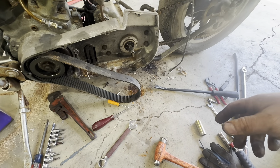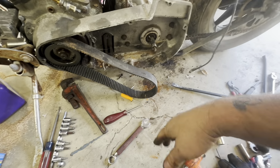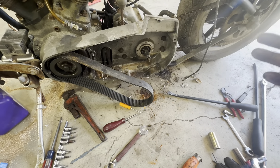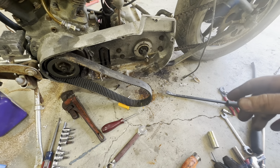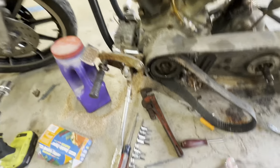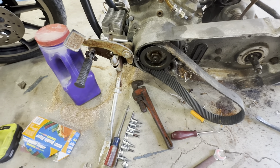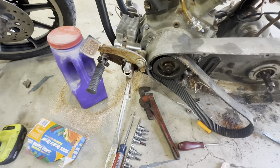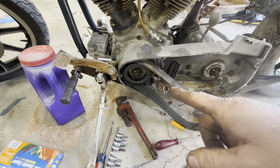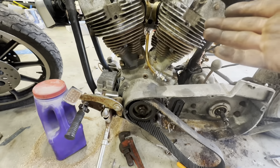People will go around and beat the crap out of it at an angle, but all you've got to do is put your pressure on and hit it straight. It's just like taking a bearing out of a flywheel using grease and an extension — there are all kinds of little tricks to it. Now I need to find an inch-and-a-half socket because that nut is massive. This one is regular thread, and I've already got it soaking in PB Blaster. Once I get that off I can get the housing off and the belt off, and then I can finish pulling the engine off.